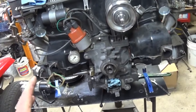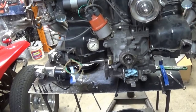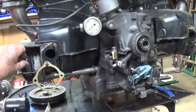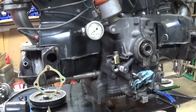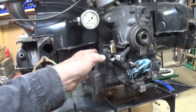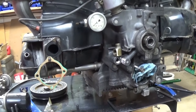I ordered heads before I started the rebuild because I knew I'd need them. When I tore it down, I found out it's actually a 1600. A buddy of mine in Arizona was building a 76 by 85.5 - just stroking a 1600. He was telling me all the problems: clearancing things, things moving around, all the spacers under the cylinders. I took note of that and decided to go with the 74mm crank instead.